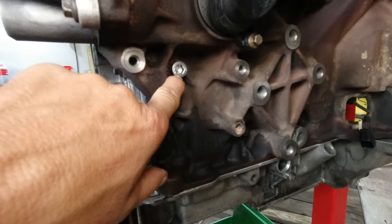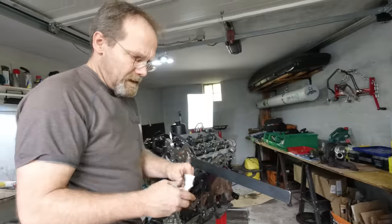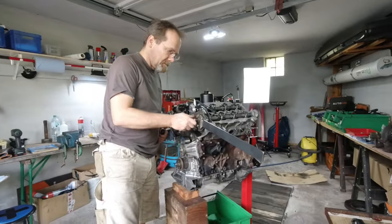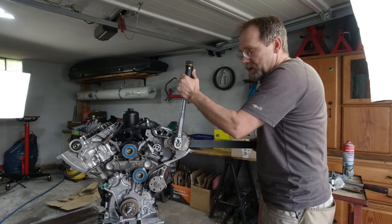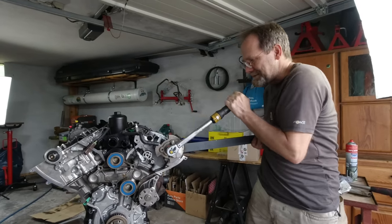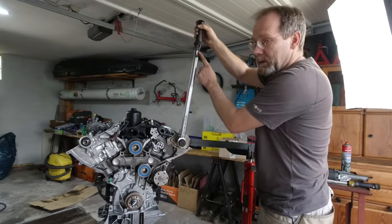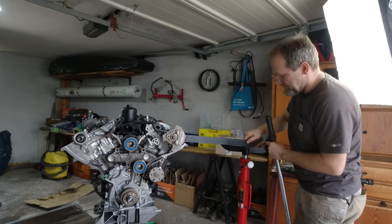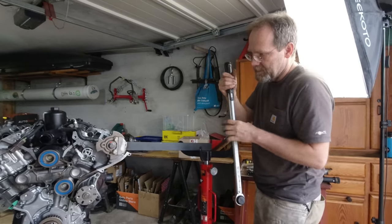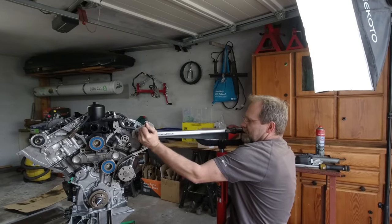The crankshaft is timed right now — here's the timing pin into the key. We have new bolts because we already used the old bolts three times. I've got to make sure I keep the camshaft in the area where it is not hitting the valves onto the piston. Setting to 80 Newton meters first — minimum torque is 100 Newton meters, maximum is 200 Newton meters, so I've got it set to about 130 Newton meters. Going 90 degrees — the torque's not climbing, so that's okay.